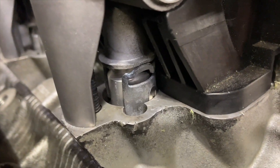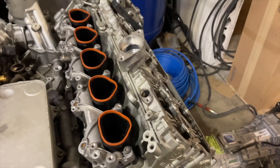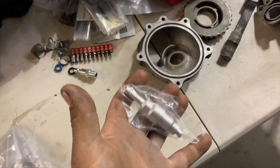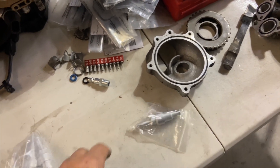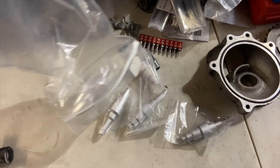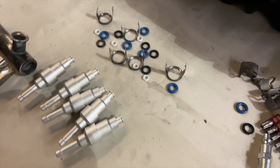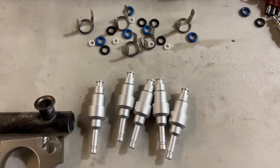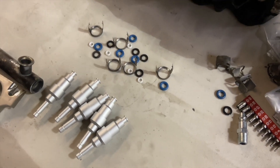On this side I got the lower intake all together. In there are the direct injection plugs — not gonna be running any of that anymore. It's gonna run on a set of 850 injectors from Fuel Injection Connection. I had a guy make me ten of these — they're little replicas of the direct injection fittings. Got those all assembled. You gotta get all the seals and everything on them and get them put in.